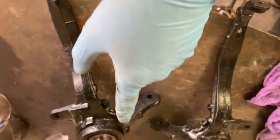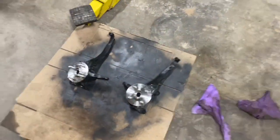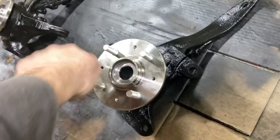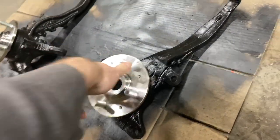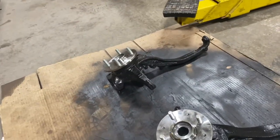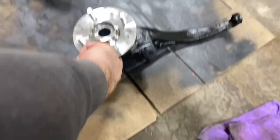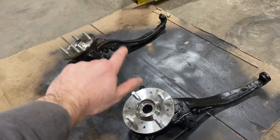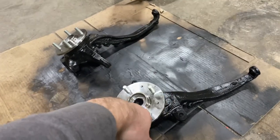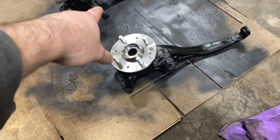Both wheel bearings are in. I put the snap rings in with snap ring pliers, then pushed in the hubs. The hubs and bearings came out pretty mint — they look really good. I have some paint flaking off on the spindle but I'll touch it up later; where it flaked you can't even see because it's underneath. I had to press them a few times since it was going in off-center, but got it fixed.